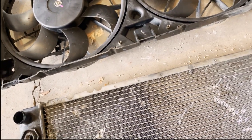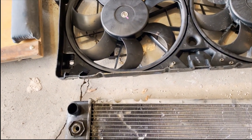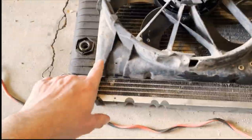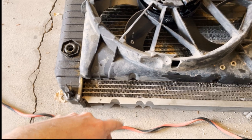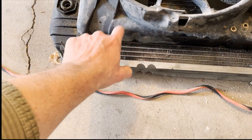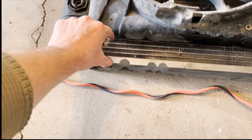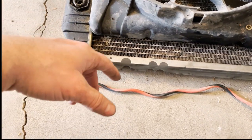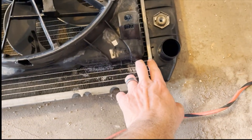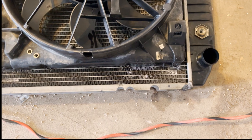There's one more thing I want to do. We're going to go see if we can find a hardware store open on December 31st. I need some sheet metal - little small strips to put in here. I want to protect this and keep this from happening again. Ideally you'd have a tight seal around all of this. A 2008 Suburban, which this shroud is supposed to match, is about two inches shorter. I've thought about putting one of those radiators in instead, but I think that extra gives us three or four different cooling channels and I think we need them. This is half an inch short and doesn't seal up there, and how would you even find a shroud that's actually correct that way?